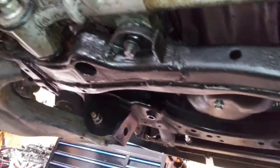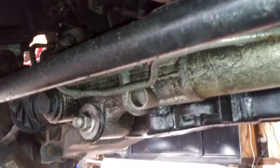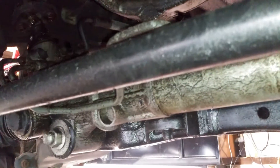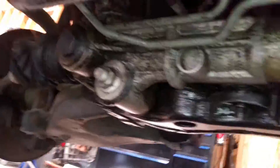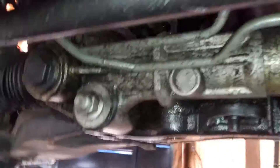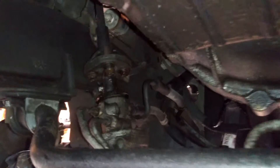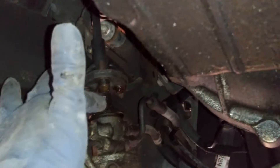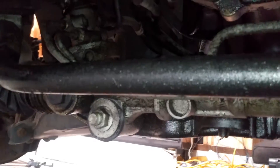This is the most important piece. We're going to need something like a little catch can to catch all the remaining power steering fluid that comes out. We're going to need an adjustable wrench to take off one of the bolts and some pliers to take off the low pressure hose. My customer complaint is that the power steering is making a lot of noise — I found it's leaking a lot right here, which is sucking air and causing that growling sound.